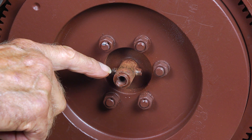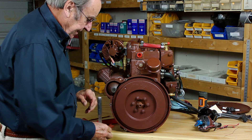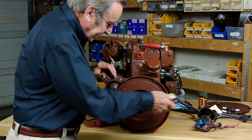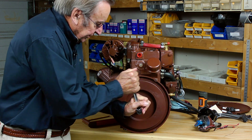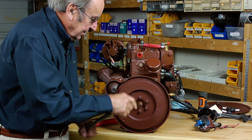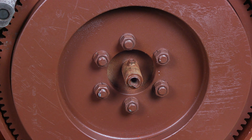With the roll pin horizontal, the piston is just starting up on its compression stroke. So once again we put the timing tool back on and go with that extra 90 degrees of turn, bringing the roll pin vertical, and the number one piston is again at the top of its compression stroke.